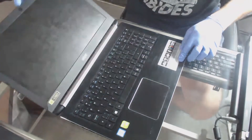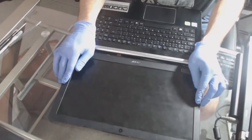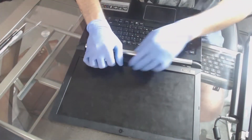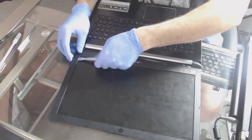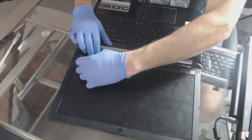Once you've got the laptop open, the Acer Aspire folds out nice and flat. You're going to want to pop off that bezel by getting your fingers underneath it. You can also use a flat tool like this one — sometimes a flat head screwdriver, though it can be a little too thick, so a guitar pick works just as well.